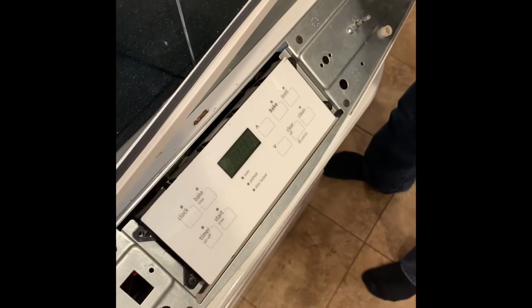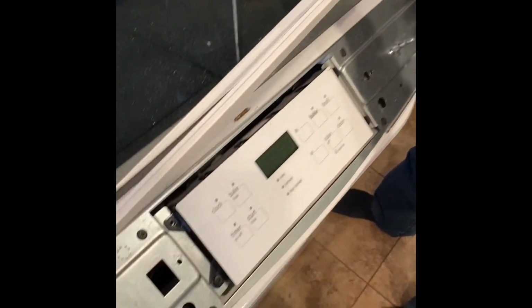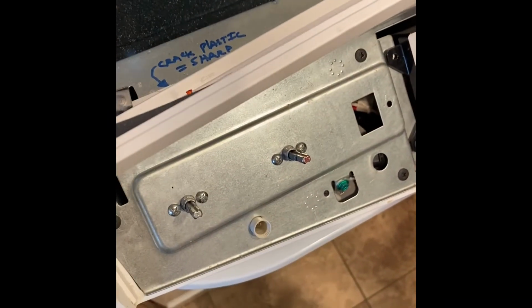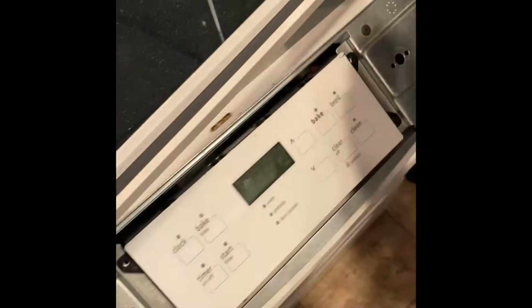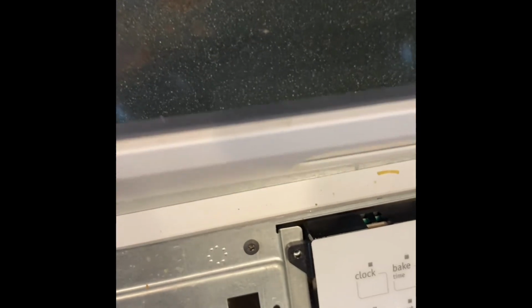There is a reason to lift the cooktop up. It's this little strip of rubber material, and if you look on the end of that rubber material, it's not quite the same. And I think this thicker half goes to the upper outer edge. And you got two possibilities here. You could put some tape on that, or if you got enough people with enough hands, everybody use their fingers to get this back down and have that rubber material be where it belongs.